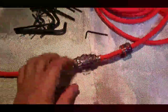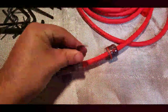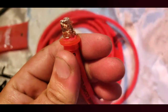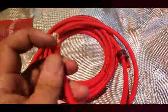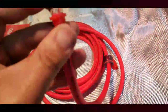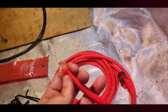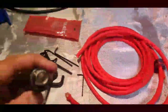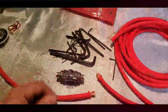I'm adding this in at the end — I was taking the included fuse holder apart and the terminal inside was actually really loose. When you look inside, you can see it's a bunch of very fine strands, and a bunch of them were pushed backwards — like hairs going the wrong direction. I'm not impressed. If you get this kit and just throw it on your car, I'd recommend checking the fuse holder connections. There were also what looked like filler/rope wires inside, but the main issue is definitely check that fuse holder before you use it.